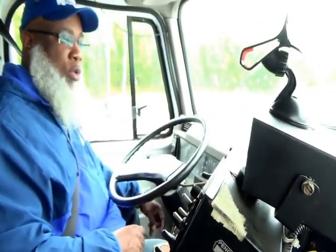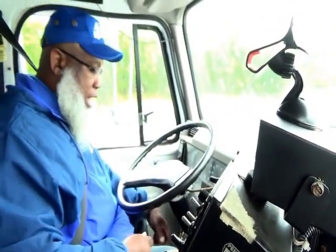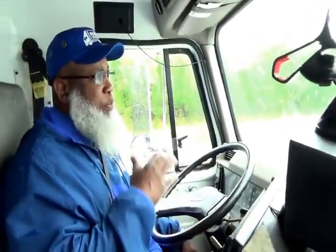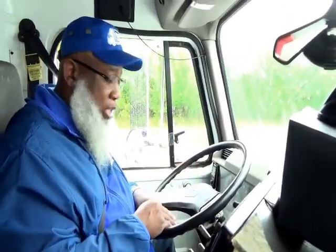Next thing you want to do is tell the DLA that you want to do your service brake test. All you have to do is put the vehicle in drive, and you don't have to do it, you just have to say it. You say, I put the vehicle in drive 5 miles an hour forward, apply my service brake, and the vehicle should not pull to the left or pull to the right. And that will be the completion of your air brake test.